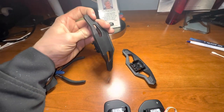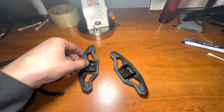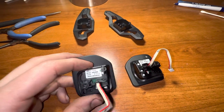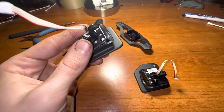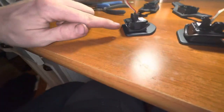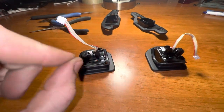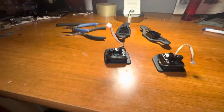These are what we're replacing with — the aluminum Urus-style paddle shifters. There are other videos online on how to do these, but none with this style paddle shifter. I honestly didn't see a better way of getting them out besides drilling a very small hole at an angle into the paddle shifter, so I could wiggle a small pick down there and push the pin out. That worked well, and given that it's at an angle, the pin can't fall out the opposite way.